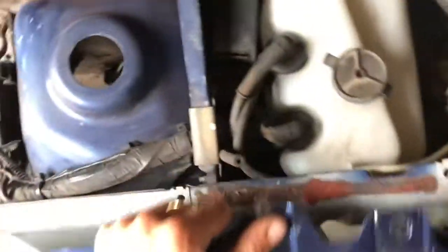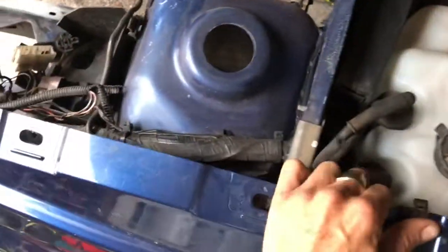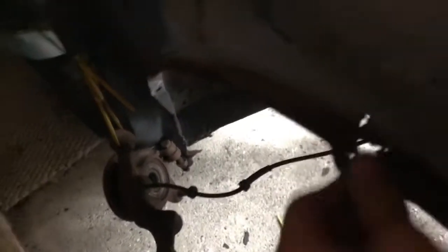I just did this yesterday — just made up this new arch slip. This section here is completely rotten away. A lot of it has been cut off. In the engine bay it was all scabby — every bit of primer you can see is where it was all scabby. All of this has been taken back to bare metal. Anywhere you can see the etch primer is where the bare metal was. Taking all the rust out. The other side is literally as thin as paper. We've still got to do that side, but all the panels are there and they're all nice and straight.